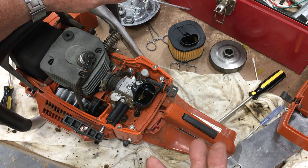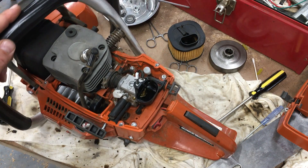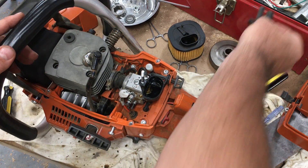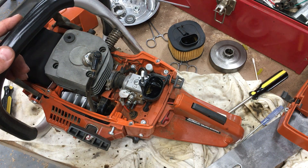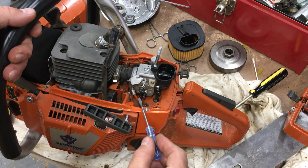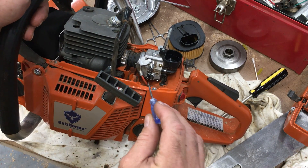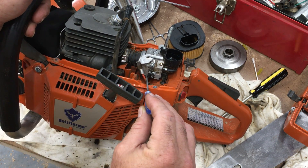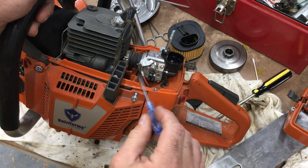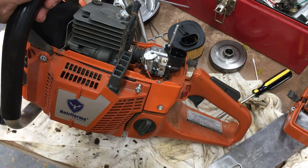Over the course of Saturday and then Sunday afternoon after church, I discovered I had two problems. One was that the gaskets and diaphragm inside that carburetor weren't the best. The other issue is that my low screw here is backing out on me. I ran this for that two or three hour period and had it dialed in perfectly — I think it was about one and five-eighths turns, which worked out optimal on this particular saw.